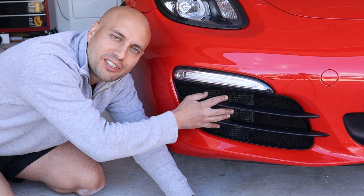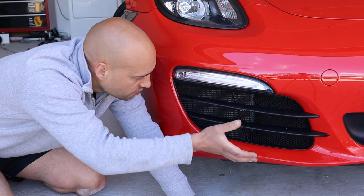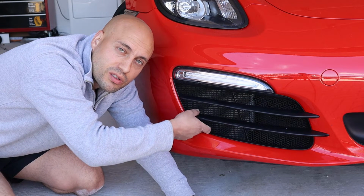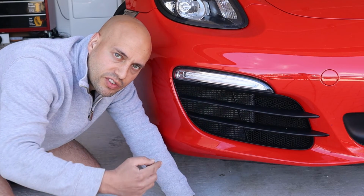The car is clean, let's get started. No prizes for originality, but I'm going to start with the condenser grills. Obviously a risk area on any Porsche, susceptible to stone damage and debris getting in there and rendering your AC useless either by corroding the pipework or puncturing a hole in your condenser. One on either side obviously.